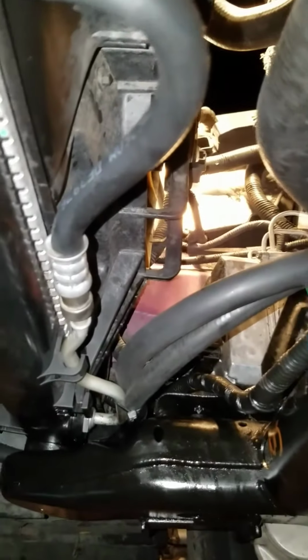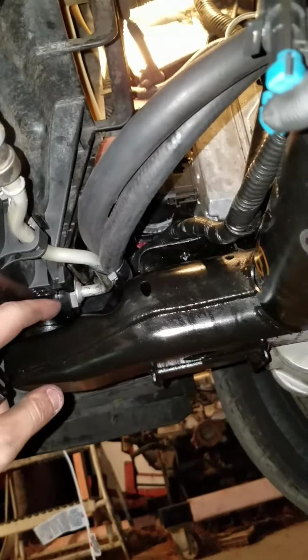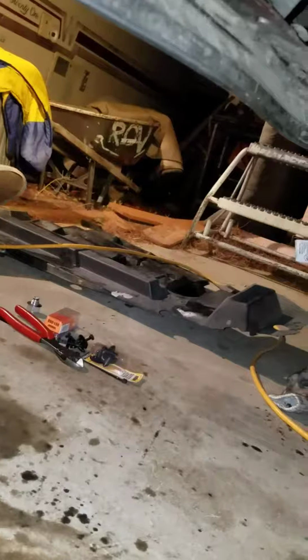No coolant, no transmission fluid flows in here, so it's just kind of sitting there. It's not going to fall off, not going to leak, so I just leave it. Those lines coming down from the trans cooler run under here, around the back side of the frame. If you don't have enough hose, you could literally run them under here. It wouldn't matter because that big piece of plastic covers them and you don't see them. I'm going to put that back on in a few minutes.